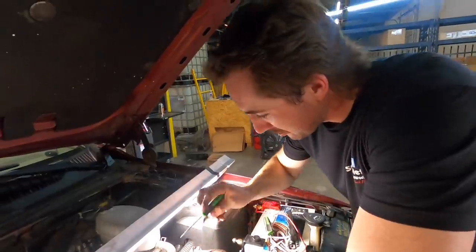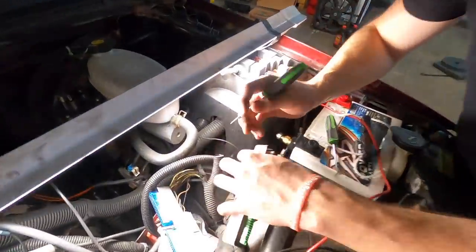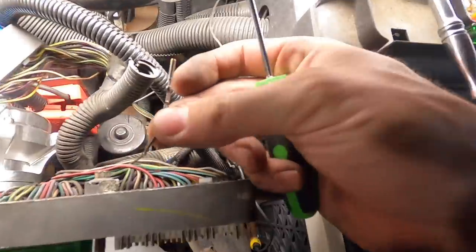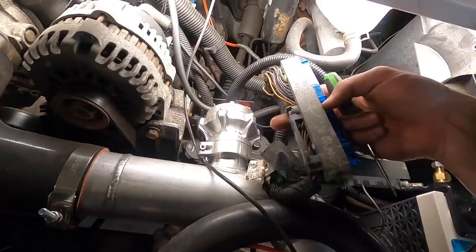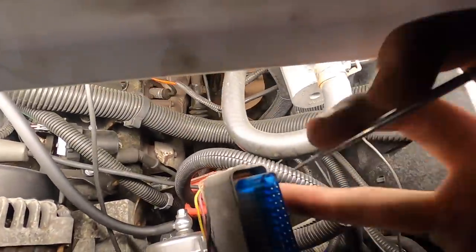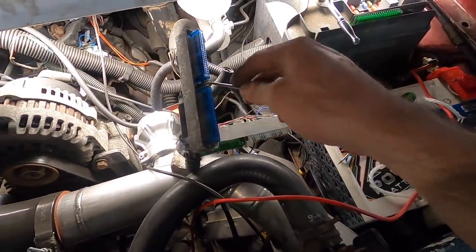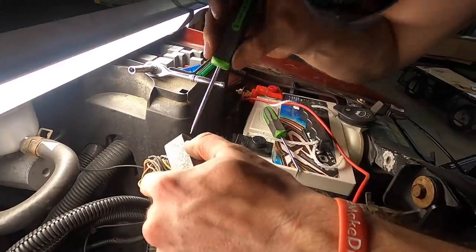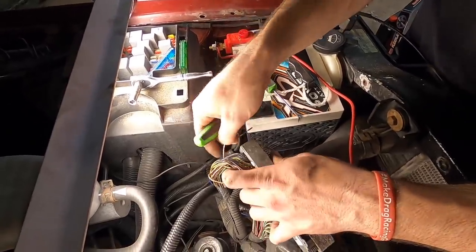Here's the little pin clip we have to lift up to pop the wire out - these ones are a lot easier to get to. You just kind of hold it up and pull on it. You don't actually have to pull the black housing out entirely. For pin 79 on the blue connector, you just need to hold the clip up and push the pin back a little harder, wiggle it, and it comes right out the back.